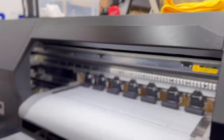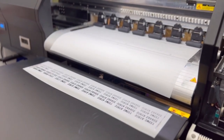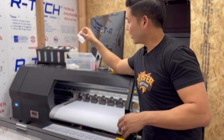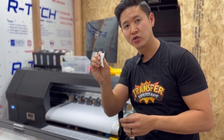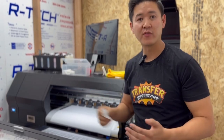The way to fix this is to let the ink completely dry, because you don't want to wipe it when it's wet as it will smear. We let it completely dry, then took a lint-free cloth and gently glided it across the encoder strip to clean it. We did a head clean, and voila — it was perfect right after.